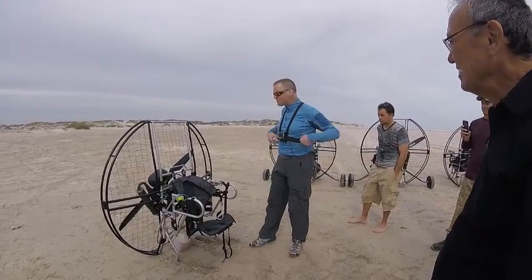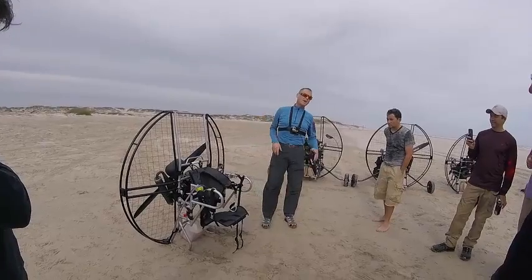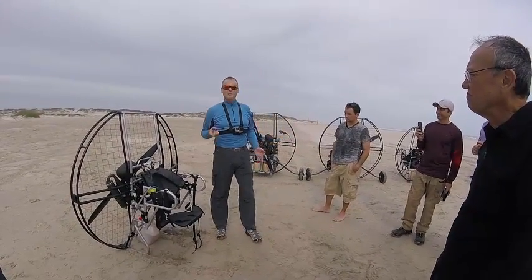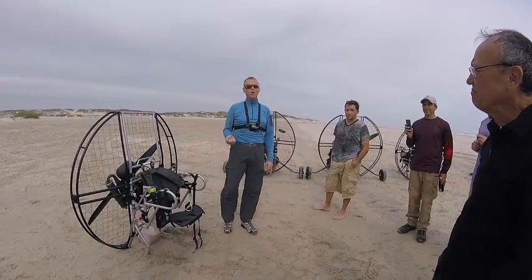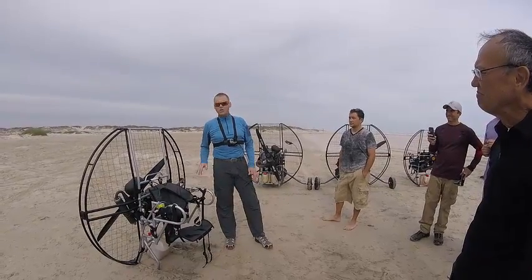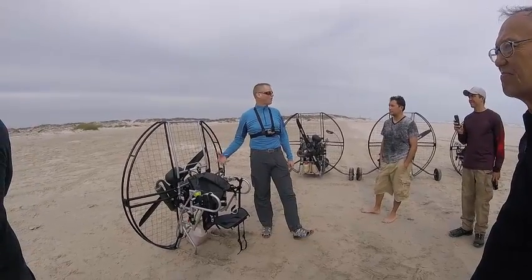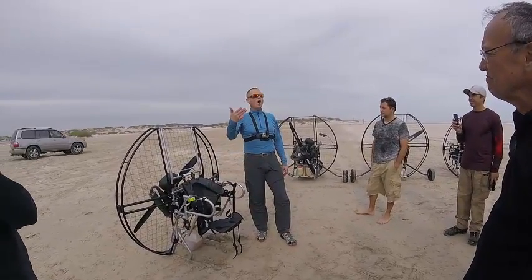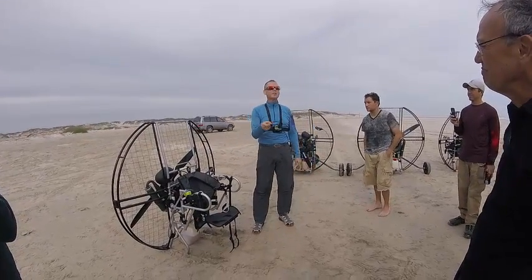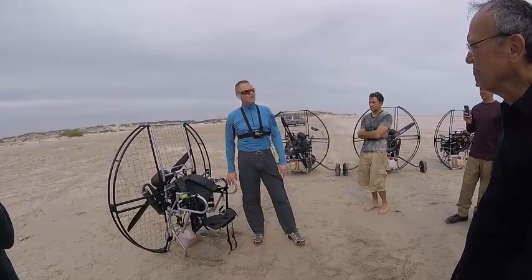These run so well, sometimes we'll just do the motor run up and not do the power run up. But officially, you should do your motor run up right before you launch. Make sure it's running really smooth and it'll hold that RPM, and it's not going to hiccup and bog the second you launch. Two strokes need to warm up, so you want to make sure it's warm before you take off, because if it's cold, it can hiccup and run poorly for the first 10, 20, 30 seconds or so. You don't have to run it up for like 20 minutes.